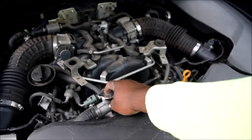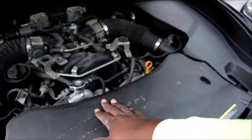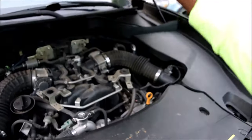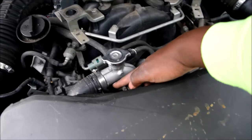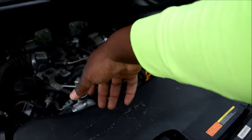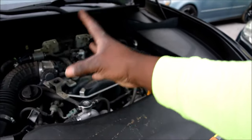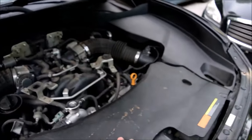That is the main reason this radiator cap exists — it has a certain pressure rating and it's spring-loaded. We'll have to wait a little bit because it got to temperature, and if I try to open this right now I'll probably get steam spraying out. When you open it, you basically relieve the pressure — which increases the effective volume — and the water that's in there will just flash off, turning to steam and spraying out because then it's going to boil.